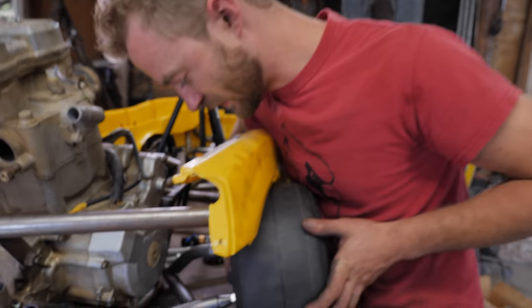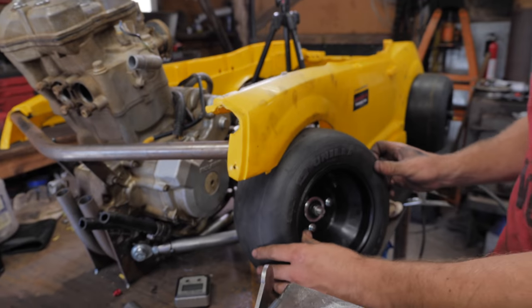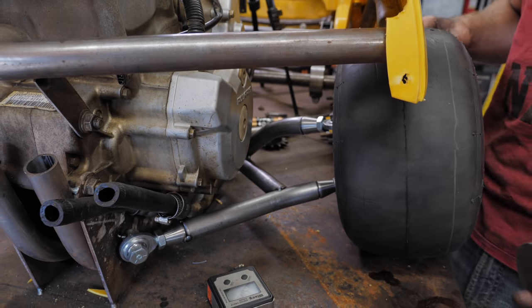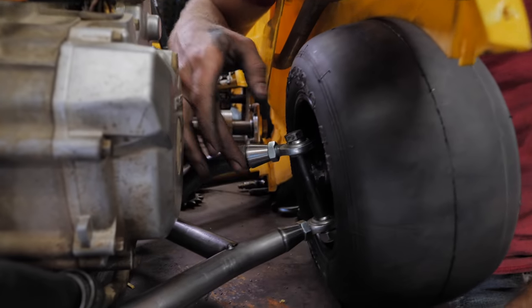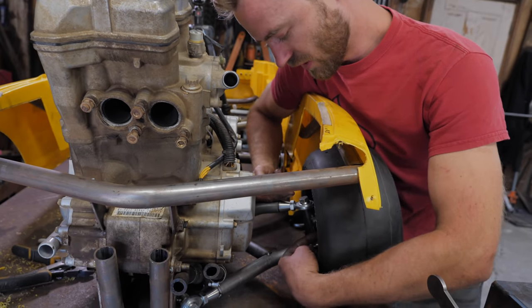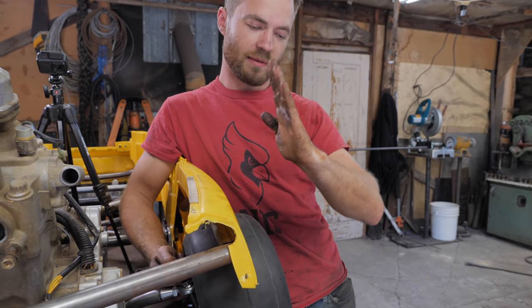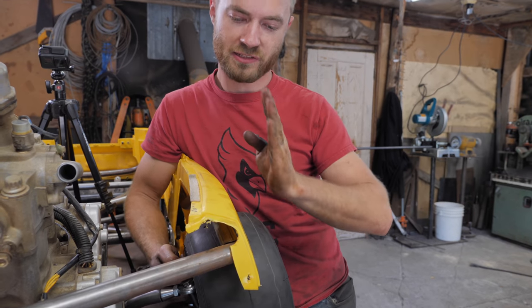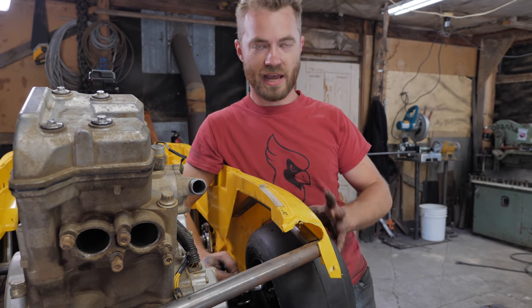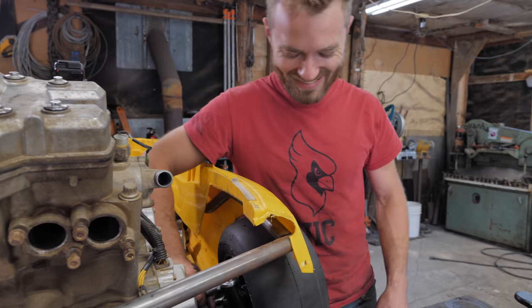I've got the left side control arm sort of tacked together. It's not completely finished, but it's finished enough that we can have some steering and some suspension travel. Not very much because right now it's fully bottomed out. These two heims have opposite effects — if you adjust this one out, it puts the tire closer to vertical, cambers the top of the tire out, and reduces caster because it pushes the top of the steering pivot forward. Or you could adjust this one closer to the vehicle and get more caster and more camber. I don't know if that makes any sense — it still doesn't make sense to me either.